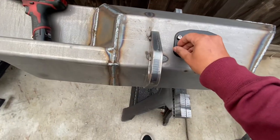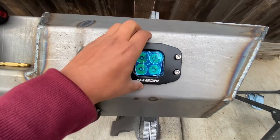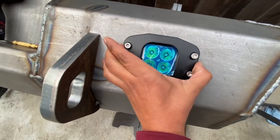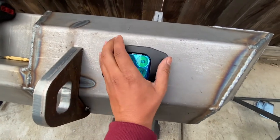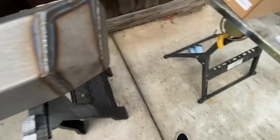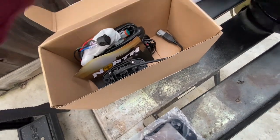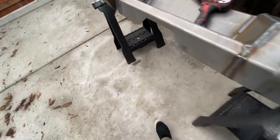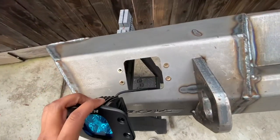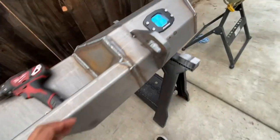This is just a quick mock-up, not the final product. You pass the bolt through the rib nut — like I said earlier, there is some adjustment, back and forth, up and down. Ideally you would install each bolt, put some thread locker on there, and yeah, it's that quick, it's that easy. Same thing on all four corners and you're all set.